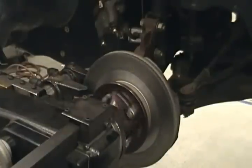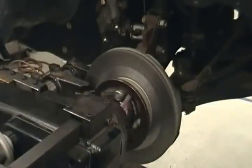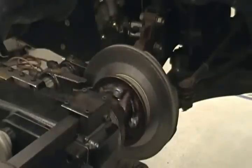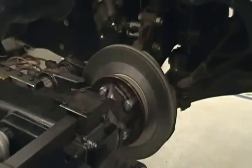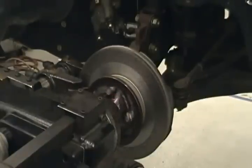Because whenever you cut one, you're cutting it to wherever it's mounted. So if there's a difference from the car to the lathe, we may not be true to that. Honda even had it one time where they didn't make an adapter to cut their rotors on the bench lathe, to force people to have to use one of these.